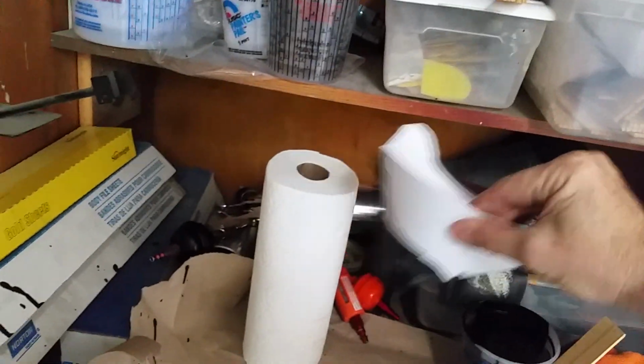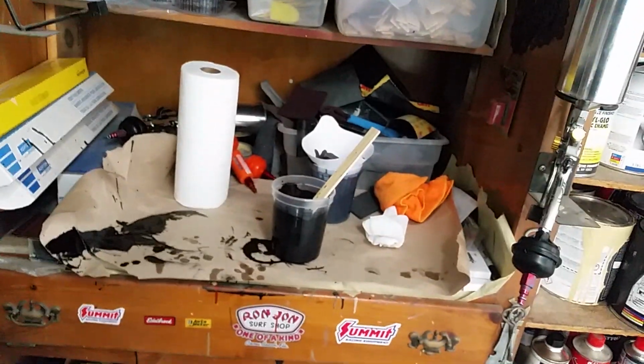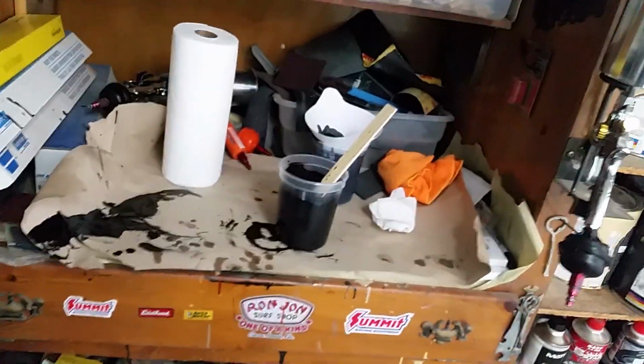If you're straining your paint, which you should be, double up your filters. Some of the filters you'll get have a really big mesh, so just double check and just use a double. I mean, they're cheap. You get them for free if you buy your paint stuff, you know. And of course, wear a respirator unless you want to pee blood or cough all night.